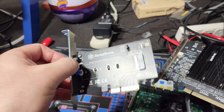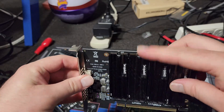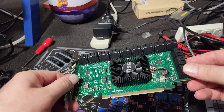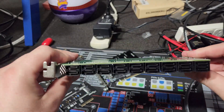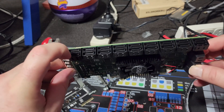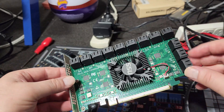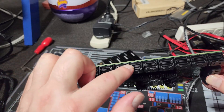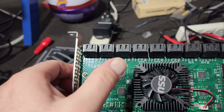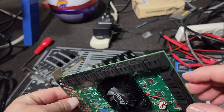It's essentially using one of these, which is fine. These four cards are going into separate projects anyway. As for the RAID card, I was very surprised — it went into Windows 11 with no problems. However, the performance is going to vary somewhat, so you'll want to spread out your drive connections. I noticed that once I had them all banked up it was actually a little bit slower — I'm guessing the SATA controllers weren't being fully utilized.